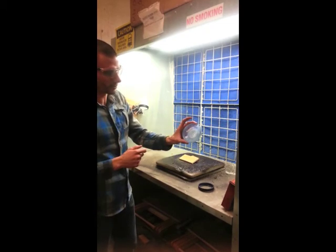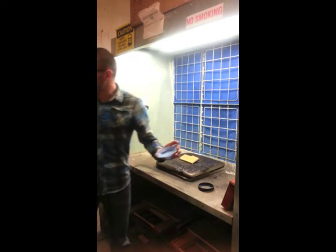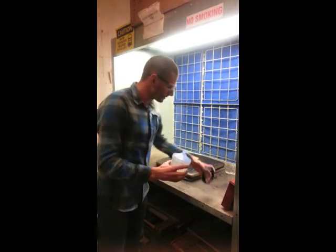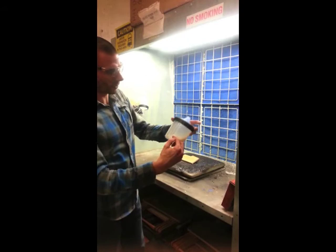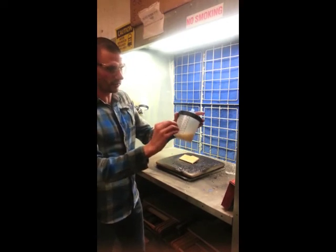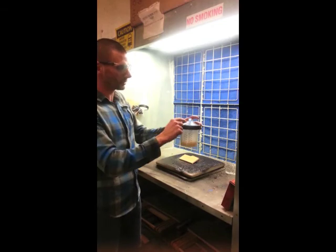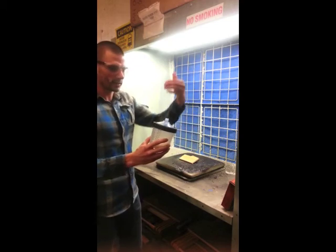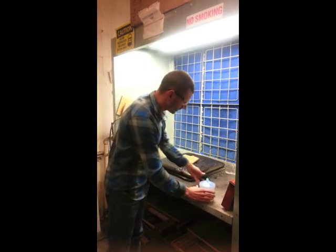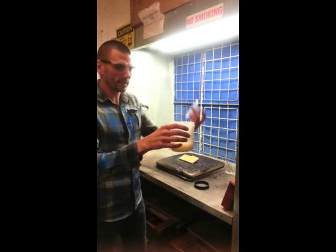It's really important that we wash out the filter area. If it isn't cleaned, when the next person goes to assemble the gun the filter will be dried up with hardened resin and the clear coat won't flow through. If you remove the filter, small particles and gel chunks from the tank will go into the gun and clog it — so do not remove the filter. I have extras; if the filter is dried up, let me know and I'll replace it. It will not dry up if everyone finishes by taking this to the sink and washing out the cup.